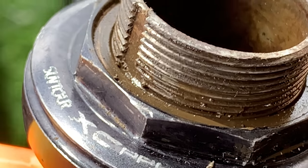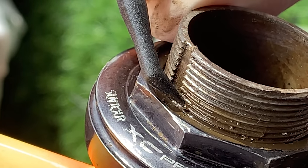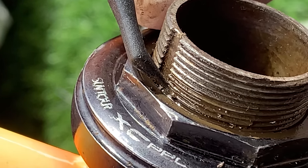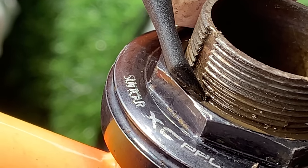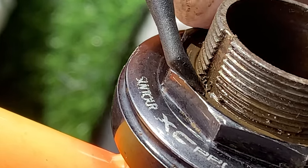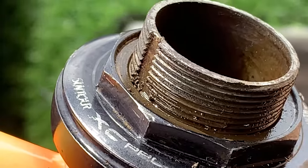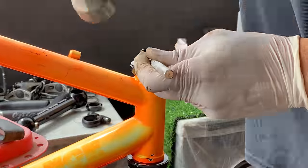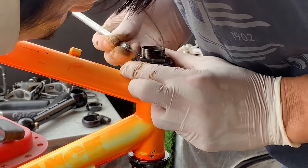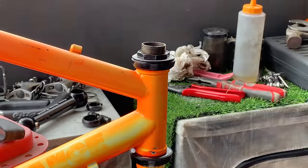So what I'm going to try to do is clean that ball. This thread here is gone because the washer tried to push against it, and that leaves this little ball here, which I need to get rid of before I unwind. Otherwise, it's going to screw my threads up. All right, so here I'm again tapping it with the end of my razor blade, trying to clean up the threads here. Hopefully, get that metal bit off, and that should hopefully fix it.